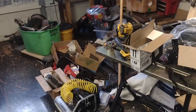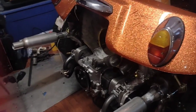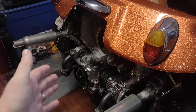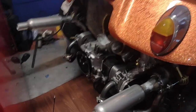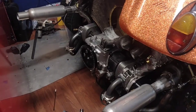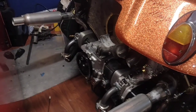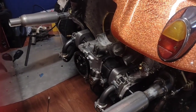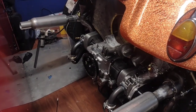And we're going to have to clean up the garage a little bit because obviously it's a mess. You know, that's what happens when you work on stuff. But that's probably going to be our next videos, is after we get the exhaust done, we are going to start assembling the motor. There's a few little coatings I want to do. I have coatings for the pistons and chambers. I have a heat resistant coating for the case that's supposed to actually help wick away heat, and we want to get all the engine tins powder coated, manifolds powder coated, and things like that. We do need to fit the engine tins, but that will probably be at a later date. That can be done when the motor's all together.